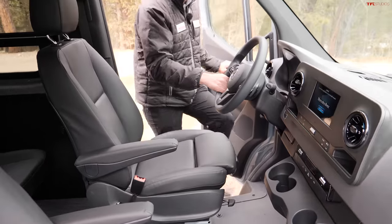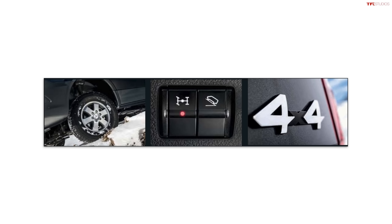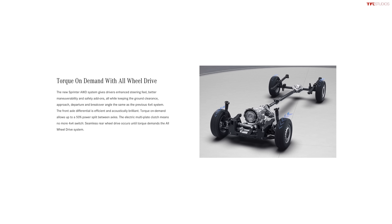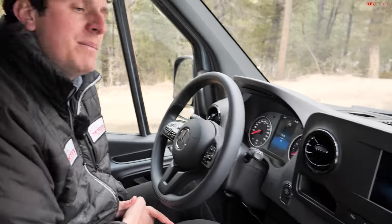The other big change in this Sprinter is actually the driveline. That new OM654 turbo diesel is mated to a single-speed transfer case. The old one had a button to engage four-wheel drive and a button to engage low range. The new Sprinter has no such buttons — instead it has a new full-time all-wheel drive system that is always engaged and always distributing torque front and back as the computer sees fit. You might think losing the low range means worse slow-speed power delivery, but the Mercedes engineers said with this new nine-speed transmission they were able to shorten the first gear significantly. As such, first gear in high range is pretty similar to first gear in low range in the outgoing model year. We'll try that out on the trail in a second.